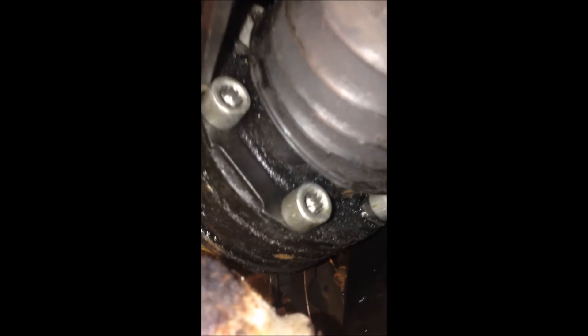I have also put the drive shaft back on. Those are all the spline nuts, and I torqued them to 40 newton meters. Next, I'm going to put the ring gear cover on, put the driving belt splash cover on, and reconnect the exhaust connector between the front section and the rear section. After that, we can lower the car to the ground again.